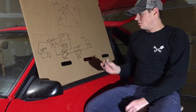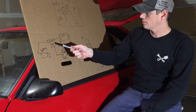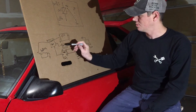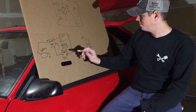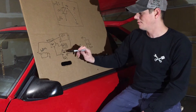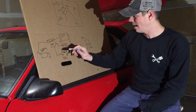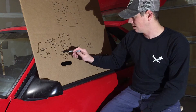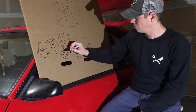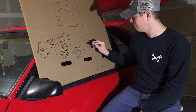So here's the full system: your fuse box distributes 12-volt positive power to everything — your key, the relay that operates your fuel pump, and your ECU. When your key turns on, you've got power to the coil side of the relay. When your ECU gives a negative or ground signal to the coil side of the relay, it energizes the relay, sends power through your inertia switch, and powers your fuel pump.